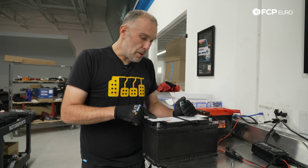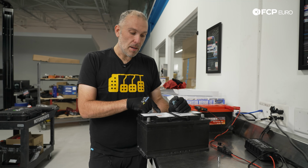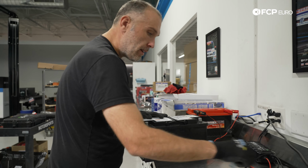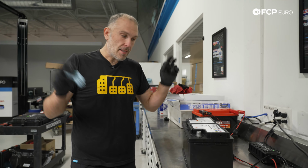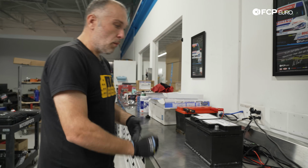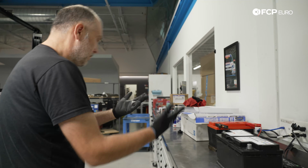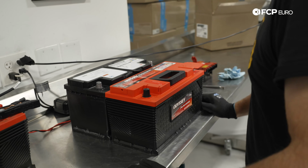And the way that we determine the battery size from this is we do have a part number on it. You can look up the part number, and that's going to go over to an H8 or a Group 49 battery. H8 is your metric sizing, so H8, H6. Group 49, I guess, is your standard sizing, but they're both kind of the same. We're going to grab the Odyssey battery, put them side by side, and we'll show you that it is basically the same size. H8, H8, same size battery.